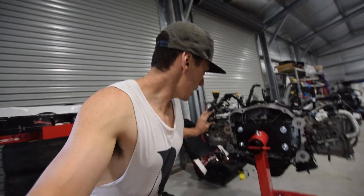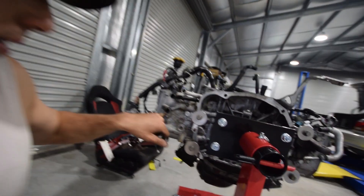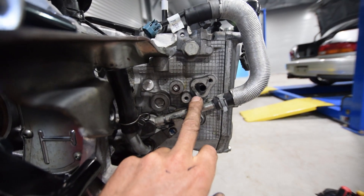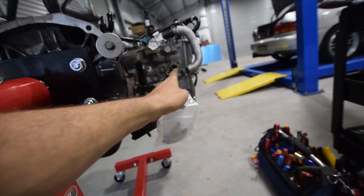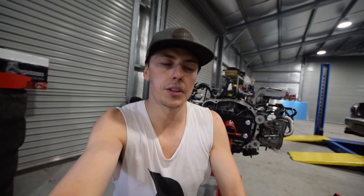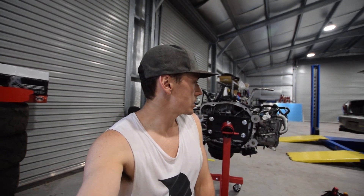Back onto the air pump. The air pump literally just sits at the front of the motor, looks ugly as anything. It goes through solenoids and pumps into here — pumps into that hole there on this side, and into that hole on the other side. These little blank-off plates are exactly cut out for those holes and come with gaskets and bolts. I'm going to put some Loctite on these bolts as well, because there's no chance I'll be able to get to them once this motor is installed. They're getting done now and they're never coming undone again.